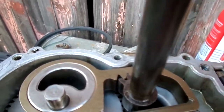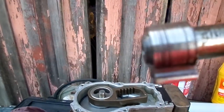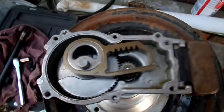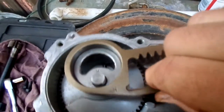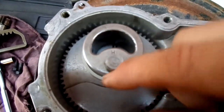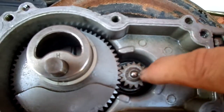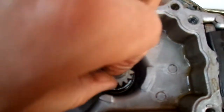The upper and lower shafts actually ride on each other but do not directly connect — that ball bearing is the only thing separating them. There's just a little half gear or third gear on it. This assembly contains this brass part, and it just lifts off of that gear. It's an eccentric hub, so it's offset to the side — it works that brass piece back and forth as it spins from the input shaft down here. And this also lifts straight out.